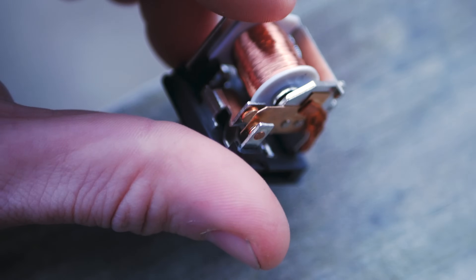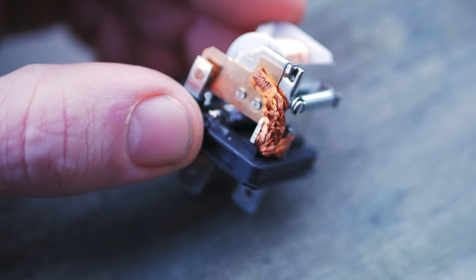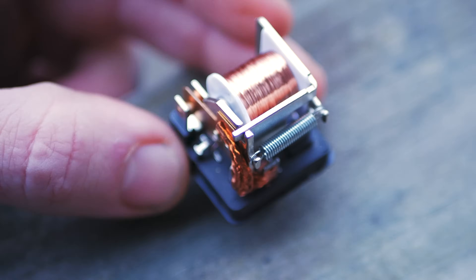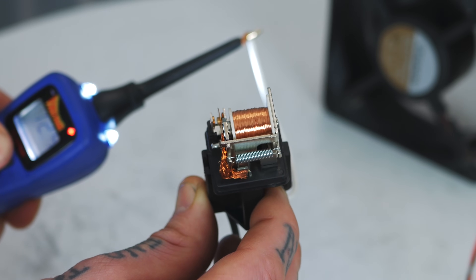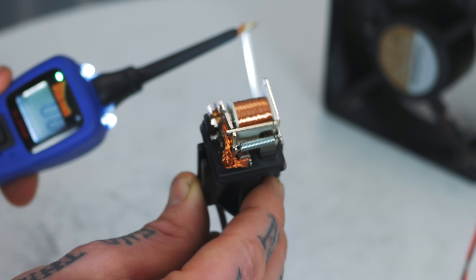With this being a five-terminal relay, it can either connect or disconnect circuits depending on which side you're wiring off of. The idea is you have a normally open and a normally closed circuit inside this relay. So you have power coming in and two terminals that allow power to head out of the relay. One terminal is hot all the time — you don't need to power up the electromagnet for that connection to work. The other circuit needs this to be energized — you need to apply power to get it to move so that power heads out on the other circuit.